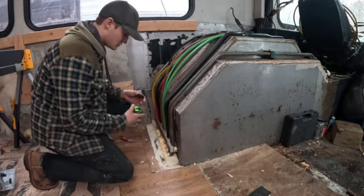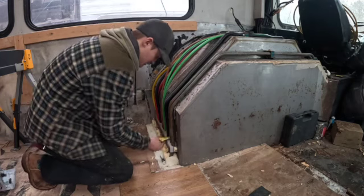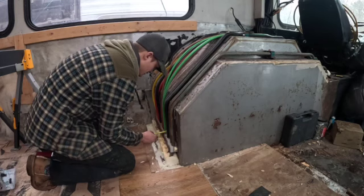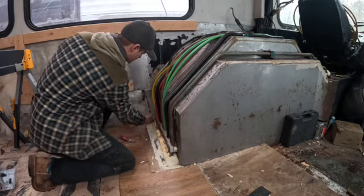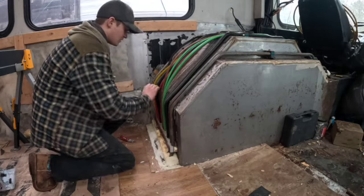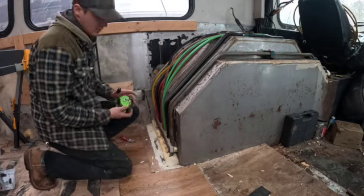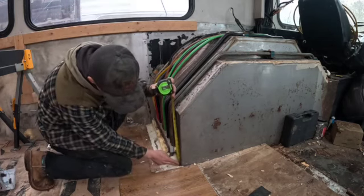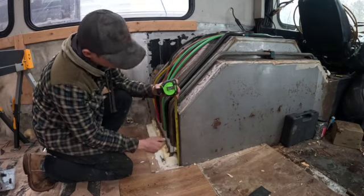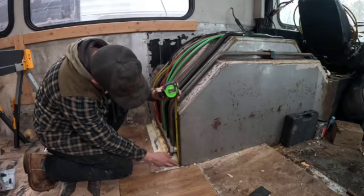And I think I'm gonna just use those 2.5-inch wide boards on end, because 2.5 looks like it's just enough to get me out over the top of all these bolt heads without cutting them off. And then it's enough to cover all of the airlines and all that stuff, even up top as well. So what I'm going to do is cut a couple of these first ones, and I think I'm going to try and cut 45s so that they mate together pretty well here. At least is what I'm going to try to do.